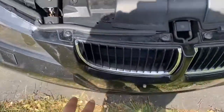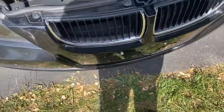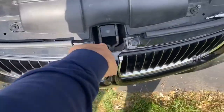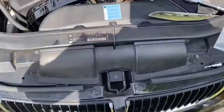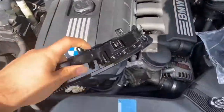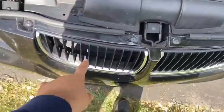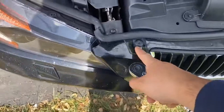Now it's gonna be time for the lower section of the grill — these two pieces right here. This is gonna be a little more tricky because to reach the tabs to pull these out, you need to undo some bolts in the bumper — one, two, three, four bolts. Then you have to reach in and pull a tab. You can actually use your new grill as a reference to see where you're supposed to push down to take off the old grill.